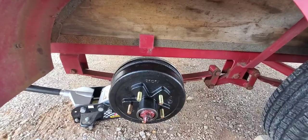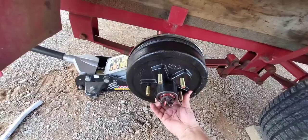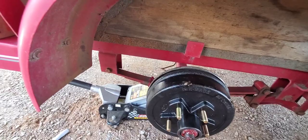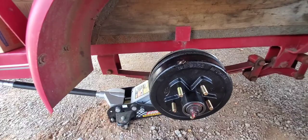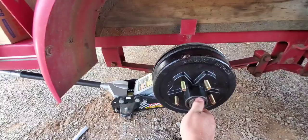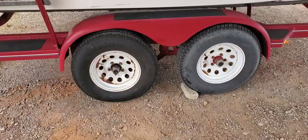Got the castle nut started back on. There's a spacer washer that goes in there — let me get that on there first. Now, this castle nut does not go on real tight. It seats it, gets it where it's supposed to be, and then you lock it in place with the cotter pin. Let me get everything situated and show you how that goes.